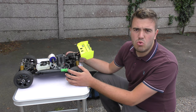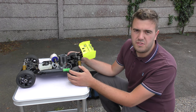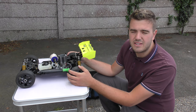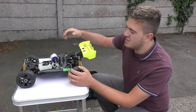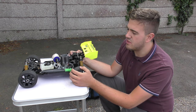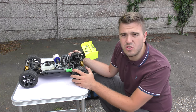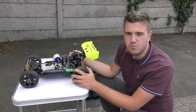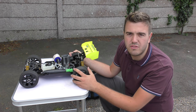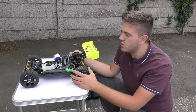So there we go, all done. Overall pretty happy with how the installation went, though it took a little longer due to a few complications — one of the engine mount screws was rounded off so I had to use heat and various techniques to undo that, and the exhaust manifold from the original engine doesn't fit properly so I've had to use one from the Ansman, modifying the mount slightly. The engine is in and perfectly functional. I will get a new exhaust as I do prefer the polished effect and I'll need this one for the other truck.